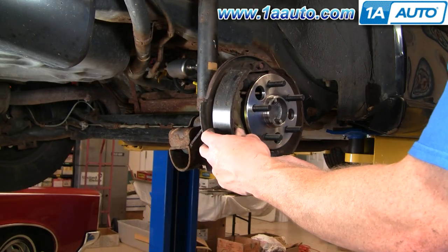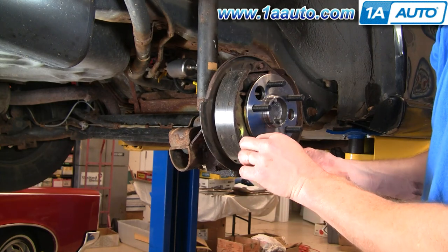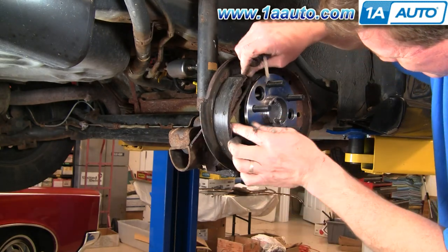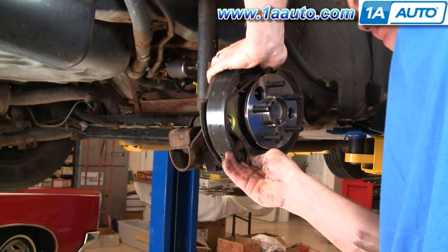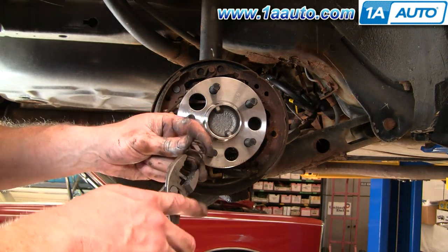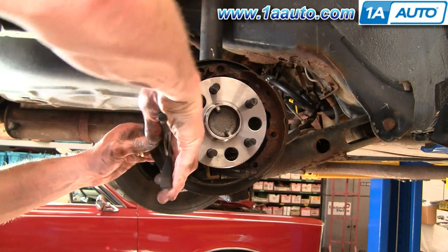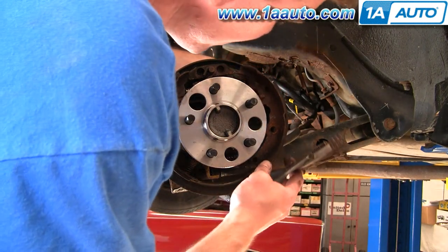Next is your adjuster lever. Put that on there. And put this kind of cone-shaped spring right in under. Then you want to hook this lever in behind there. Pull down on that lever. Push it on there. So you take it and you load it up into your pliers. Put the pin in the back here. Get it coming through. Okay. And twist it on. And same thing for the other side. Load it up. Put the pin through.